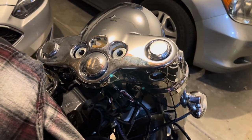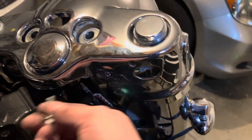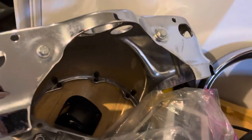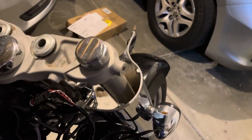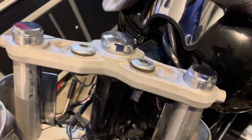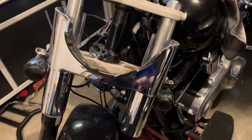To remove the upper nacelle, there are two bolts — one right here, which I already removed, and another one on the other side. Here's the part I'm replacing it with; I placed the bolts there so I know where they go. After that, you remove your handlebars and the upper nacelle comes right off. The reason it has a nacelle is because the triple tree on there is not very attractive.